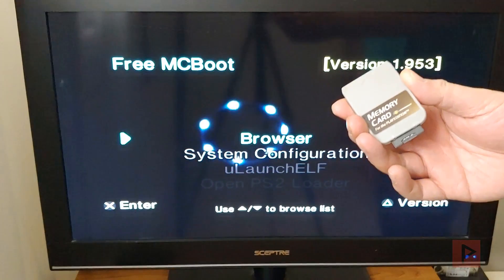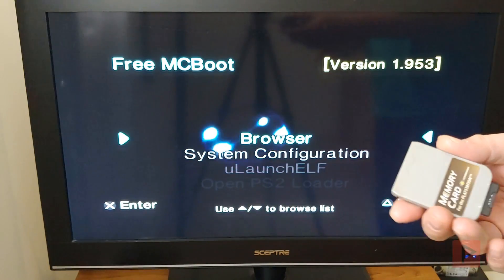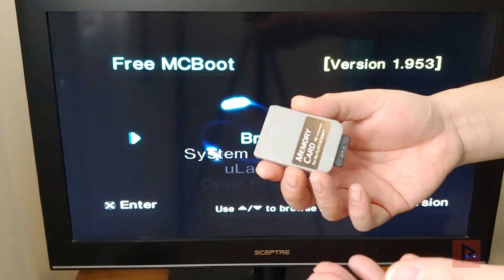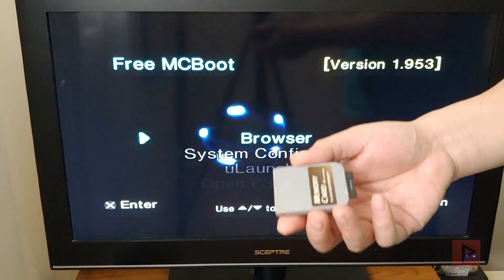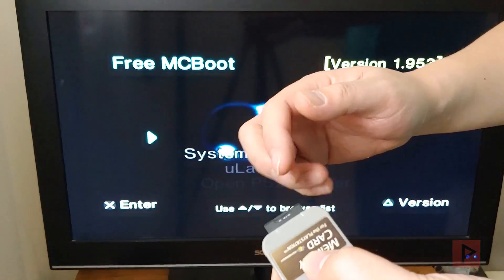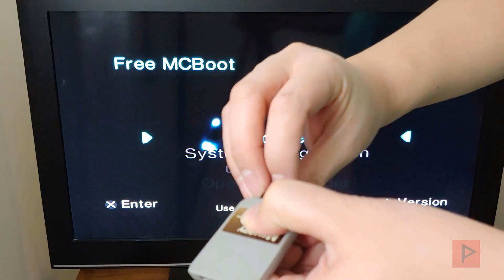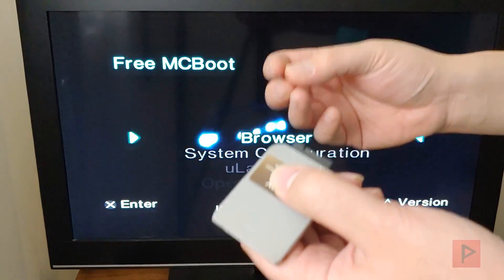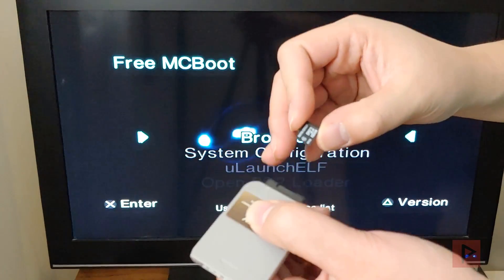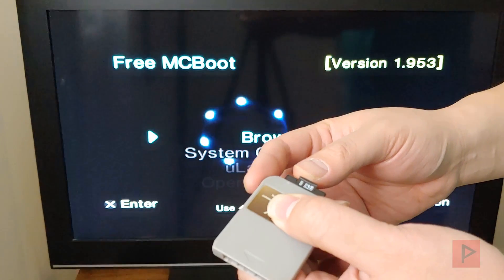This is the MX4SIO — I think that's how you pronounce the project name, leave a comment and let me know. Basically what you do is you take a PS2 or PS1 memory card, there are schematics online, you take it apart, do some soldering, desolder some chips off the circuit board so you have a flat smooth surface to add an SD card adapter — like in this example, a micro SD. The whole premise is using a specific version of OPL to load PS2 games directly off memory card slot 2. It's faster than using USB, and I think it's a pretty cool project.